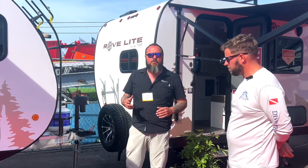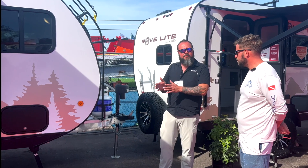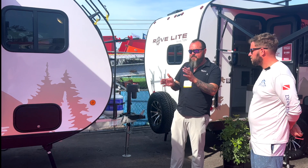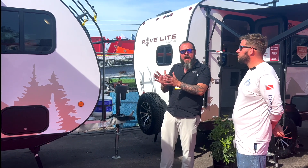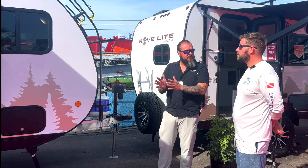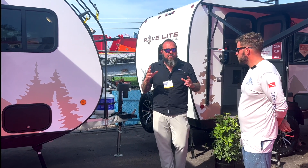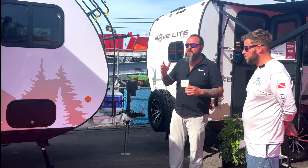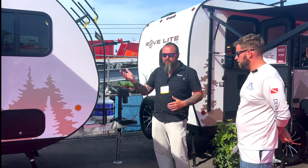The floor is actually a honeycomb composite material. The walls, on the inside, have two-pound fire retardant foam in between. The exterior is gel-coat fiberglass, and we actually two-part epoxy that together and then vacuum bond it — so it's not a water-based glue. Our goal was that the biggest enemy of an RV is water, so we wanted to make sure our structure didn't have anything that could be damaged by water.